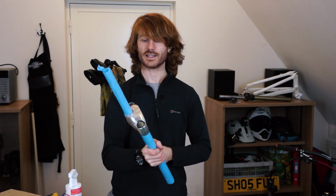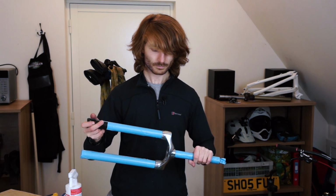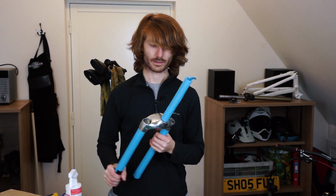So, got a top crown, wrapped all the important anodized bits and anything I don't want to mess with in some vinyl for protection, and gave all that aluminium a good polish. That's gonna give a good base, because we're gonna have to give this a coat of primer so that the gold leaf will have something to stick to. If we put it onto the raw aluminium, it's gonna be too easy to rub off.